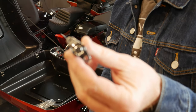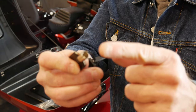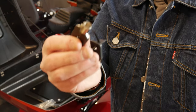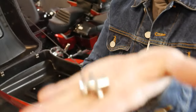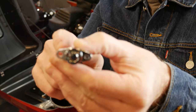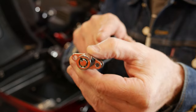Here's what you get: a locking mechanism that goes inside the latch on the tour pack, plus another set of keys. Before installing the new lock, try these keys on your ignition and saddlebags to confirm the keying is correct. The installation is simple — basically just two screws that go through the tour pack latch. You remove those, take out the old lock, and put the Harley version back through.